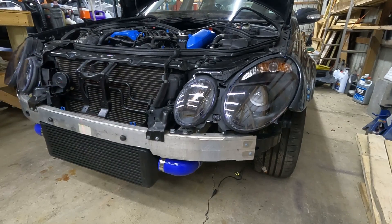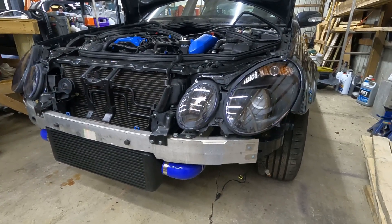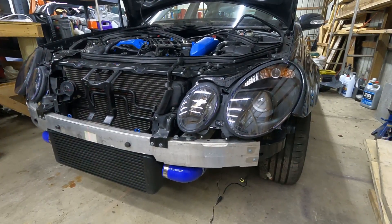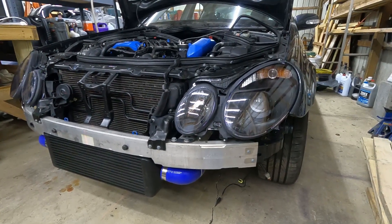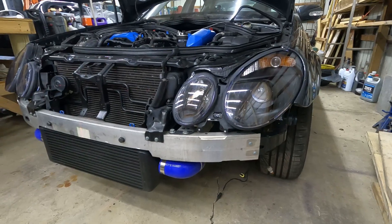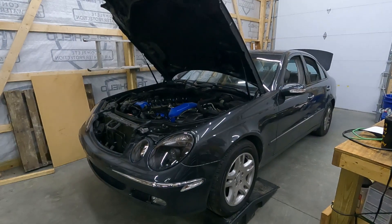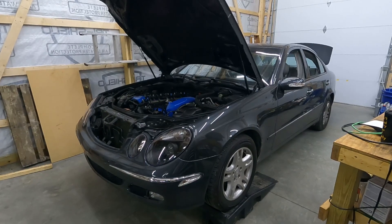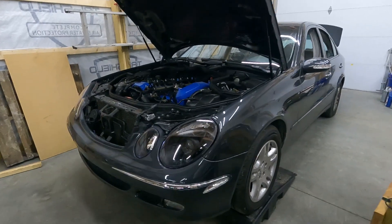After all of this work, the intercooler was now tucked up into a nice neat position. I went back and checked the intercooler hoses again to make certain that the movement wasn't going to cause them to rub up against anything or kink anywhere - and that's still the case. There was enough play in the stock intercooler hoses that this configuration still worked quite well. When I put the new bumper cover on, you can see that it actually fit quite well and the intercooler was a success. Checking up underneath, there is some space between the intercooler and the front bumper cover now. This was a success, and thanks for watching.